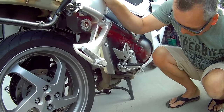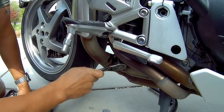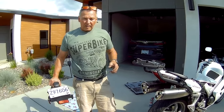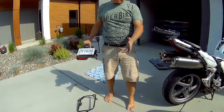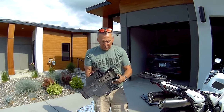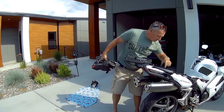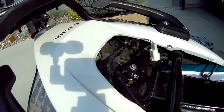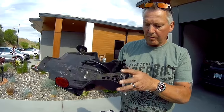It's a 12 millimeter bolt on the exhaust. So what I've had to do here - I took my side racks off because they're easy to take off and give me more room. Then I figured out I've got to remove the tail section as well. That was four 13mm bolts - two here and two here - so four of those bolts come out. Disconnect the electrical connection, which is here, and then your whole tail section will just pop out.